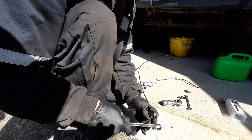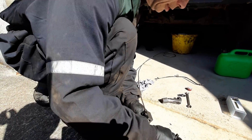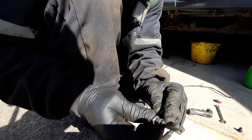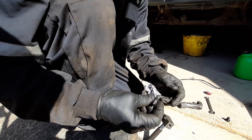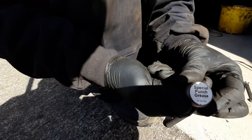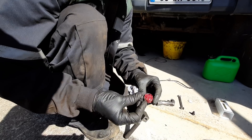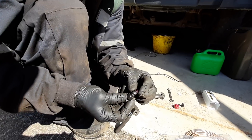A 16 millimeter hex is used on the actual forming tools. This is the actual punch — this side is for the single flare, and turned around, this side is for the double flare. I recommend using the special punch grease. It says 'do not eat' — always a good idea, not good for the digestion. Apply a little grease to the end of the punch.